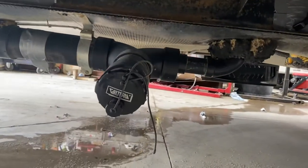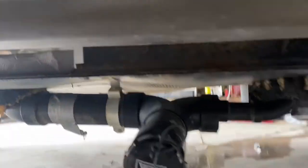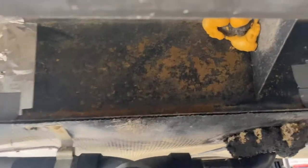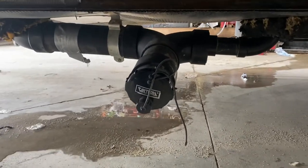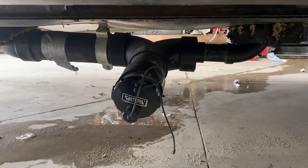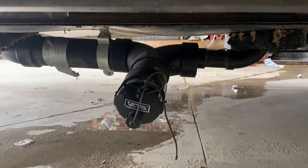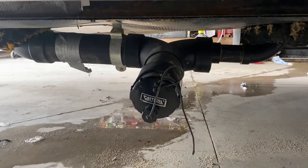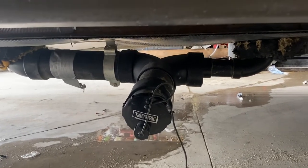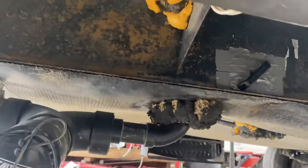Here's the other end of your sewer connection. On the left you've got a black valve, on the right a gray. The gray valve controls your gray tank, which is filled from your kitchen sink and shower. The black valve controls your toilet. When dumping your tanks, do the black first and let it drain completely, then do the back bathroom. Once that's done, come back over and finish with the gray valve on the right — it's typically your cleanest water, which helps keep that hose as clean as possible.